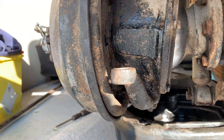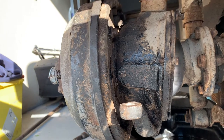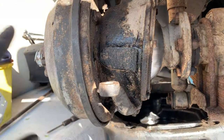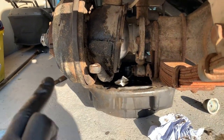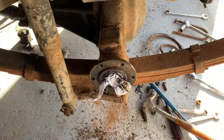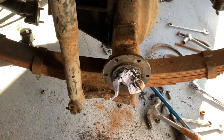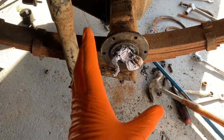A little bit of degreasing on this side - I've already detached the prop shaft. It's slightly scary to find that the brake back plate is actually loose to the swivel, which is a bit concerning. The annual inspection probably would have picked that up but it's been delayed because of COVID, so it's just as well I'm rebuilding this. I've loosened off the nuts at the top, I'm going to take the ones off at the bottom, take the split pin and castellated nut off the drive shaft, and take the brake back plate and the swivel housing off. I've taken the swivel hub and housing assembly off in one bit on the driver's side.